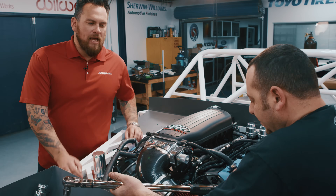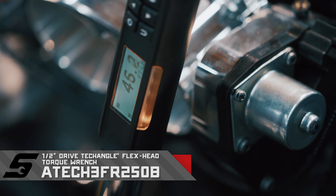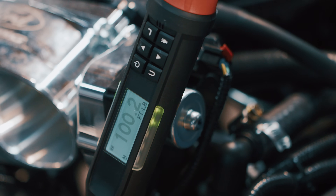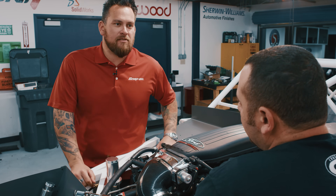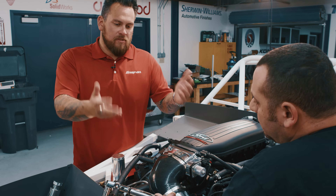Tony, I see you're taking out the brand new Atec half-inch torque wrench — looks fancy but it's got a lot of features you can use around the shop. It's got a long reach, it does between 15 to 300 foot-pounds. We just did pressure plate bolts at 30, and now we're going to the crank at 100. It also features angle measurement, which is very critical and required on a lot of these engines. We needed that for the timing chain cover — 15 pounds of torque with 60 degrees of angle.